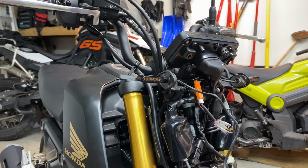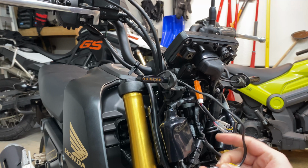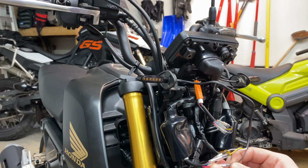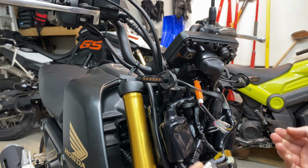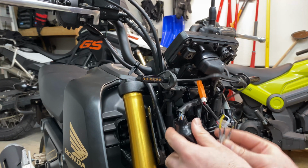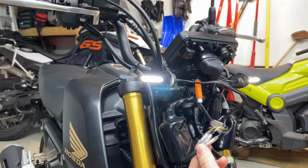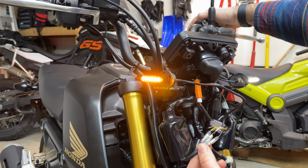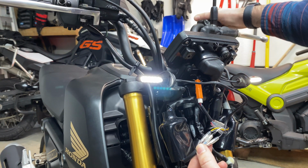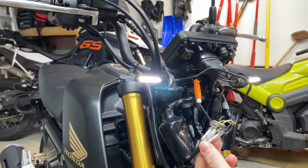So I had a multimeter out on my first one and said, you know, what wire has positive signal, and then what wire has voltages going across the two, and then looked at the polarity and kind of figured it out that way. So all right, our wires are connected. Again, this is how mine worked, assuming that they're wired the same as each other. Hey, look at that. And then right now, we don't get any turning or any blinking. So I'm going to put the headlight back together, and we will go swap out the flasher relay real quick.